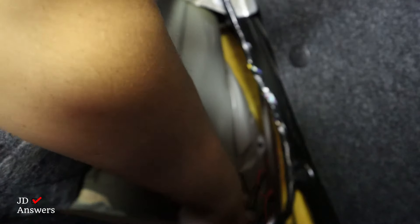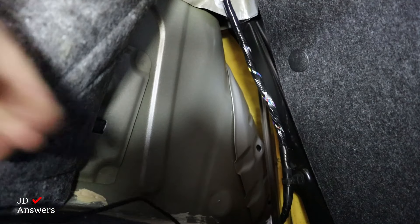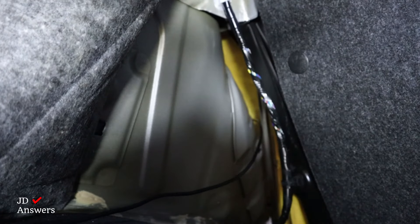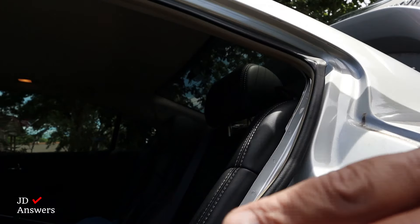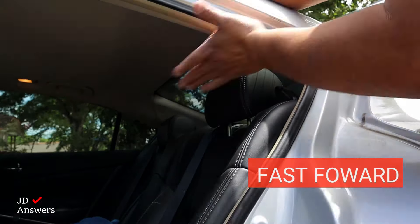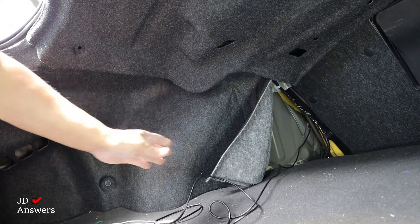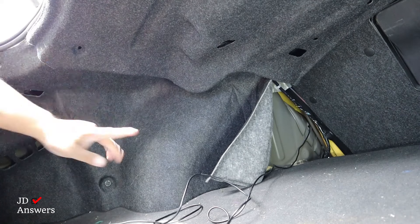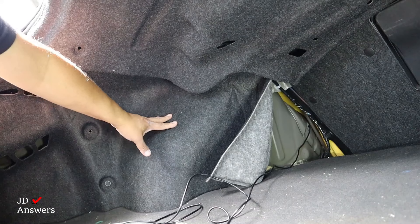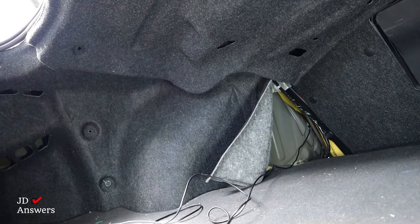This red wire here coming out — this wire too is the wire, so I can just simply pull it out and pull everything in. I'm at the end. All I have to do next is put the weather strip back. So what I've got to do next is run the wire to this trunk lid area — I'm going to go on top. I loosened all this carpet; if you're not sure how to do it, there are little upholstery clips you can take off to loosen everything.